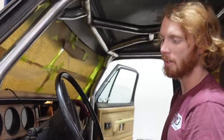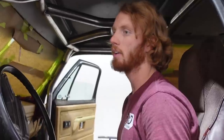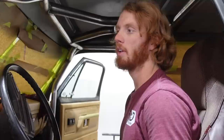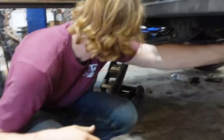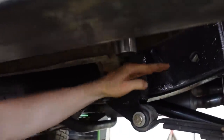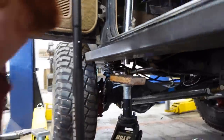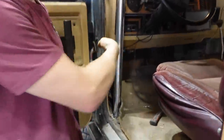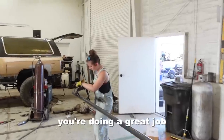I'm happy with it — I can rest my leg against that, it doesn't block my AC vent. We should still be able to get the vent windows open. Now we need to attach it to the sliders. This bar comes off pretty much level, so we'll build a platform off of there that ties from here, catches that, then into the frame. We'll do a couple more into the frame, throw a kicker in too. Then we'll finish the cage out the rear and attach into the shock towers.